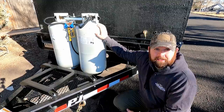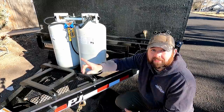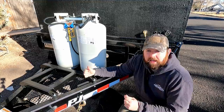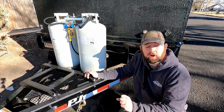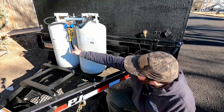Starting off, I had to make the propane mounts — welded it all on and did all the piping myself. You'll notice I don't actually have a regulator here, and there's a reason for that. Everything I'm using inside the camper has an internal regulator, so putting an external regulator here would over-regulate it and none of my stuff would work — not my Mr. Heater, not my Camp Chef stove. Once I got rid of the external regulator, everything worked perfectly. I've got quick disconnects and shutoff valves here.